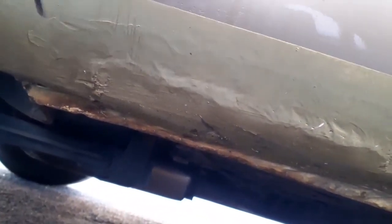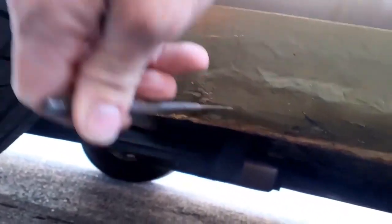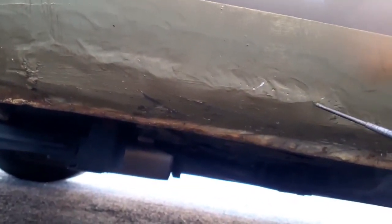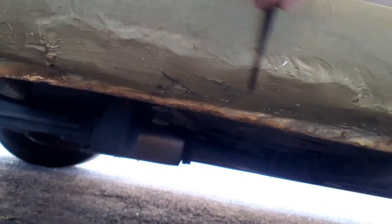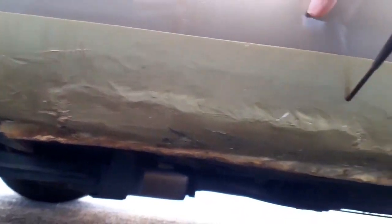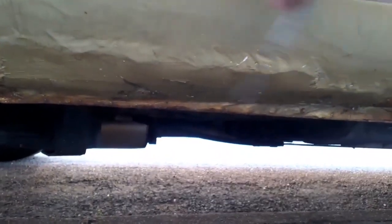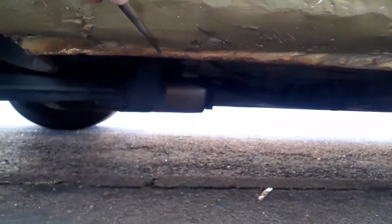It's an easy enough weld, but this is going to be a dog of a job. I'm going to have to grind all this off. I think underneath this mess it will be good metal. It's possible that they ground it so much that the good metal is thin, so I'll probably have to cut it out up to here. They've also ground away part of the lip — it's just a mess. It's just got a bloody great thick plate welded on over relatively minor rust.